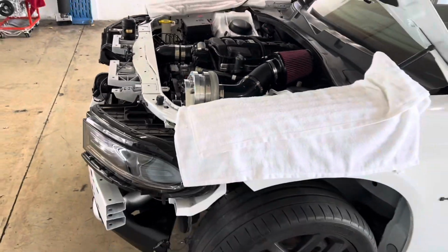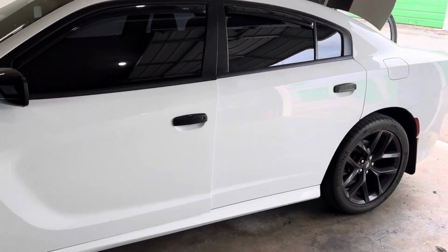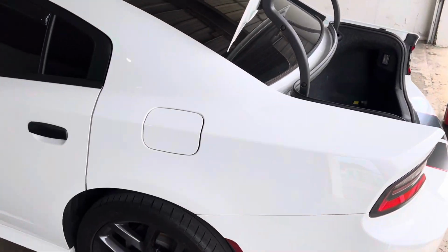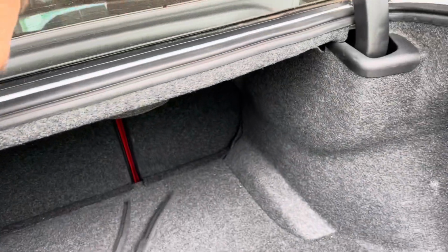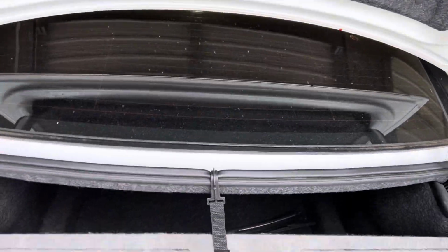This 2021 has the new fuel system in it, a newer style fuel pump that is not the same pump that was used from 15 or 17 up to 21. This is the fuel pump that gets used from 2020 to 2023. And so we added a booster pump for the Torq Storm.